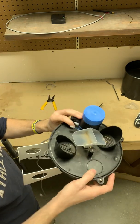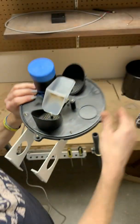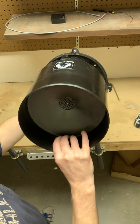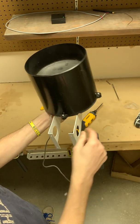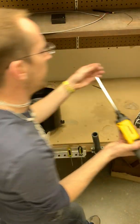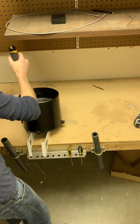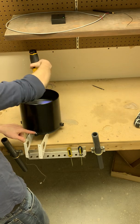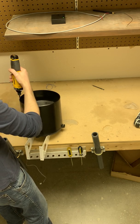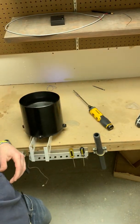That is the basis of what you're doing. I'm going to tip this just so I can hear that noise — it's very noticeable to me now. When I first started I couldn't hear it for the life of me. Place this right back on with a little turn while the latches are in place, then put the appropriate top on and tighten it up. If you are doing it on an MK3, this screw abutting the rest of the unit is going to be the one with the least clearance, so you're going to need a pretty long shaft — otherwise you'll strip your screws or improperly thread it when putting it back in. But that's pretty much it. Have a good day.